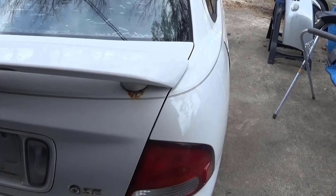Worked it out, sprayed the converter on it, then just lightly sanded it, and then just misted white paint in, then just misted the clear in a little bit. And buffed, kind of rubbed it in. Once it cured up and dried, I rubbed and buffed right in that area. If you really wanted to look for it, you could, but at first glance, you can't tell.